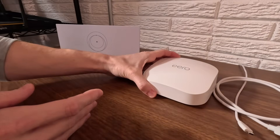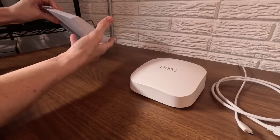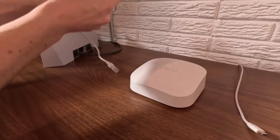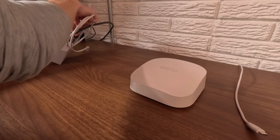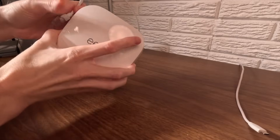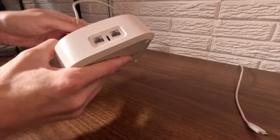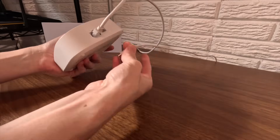So now let's hook up the Eero Pro 6E router. On the back of the Starlink Gen 3 router, there's a cover that exposes two Ethernet ports. You take your Ethernet cable — usually included with the third-party router — and plug it into either one of those ports. Then plug it into your third-party router. On the Eero, we have two ports on the back: one rated for 2.5 gigabits per second and one at 1 gigabit per second. We're going to choose the 2.5 Gbps port, and then plug in the power cord as well.